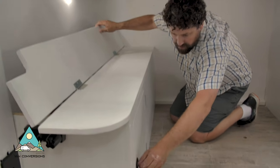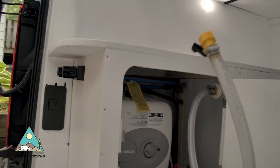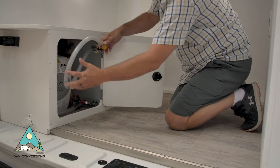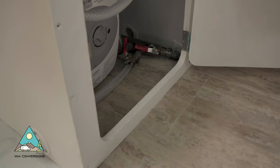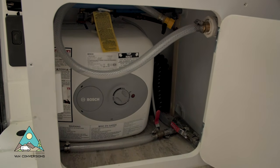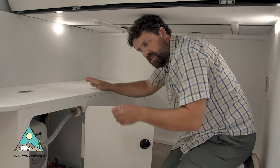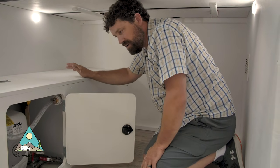The main way to fill the fresh water tank is a hose with a valve you open and connect to a water source. There's also another method I designed: by throwing some valves, you can have the onboard water pump draw water up out of the drain tube to fill the tank. This is very useful somewhere like Mexico where you fill up six-gallon jugs at water stations and transfer the water in — or you can draw water from a five-gallon bucket, a six-gallon jug, or even throw the hose into a creek.